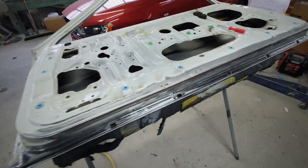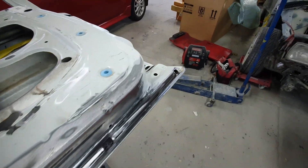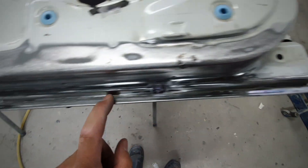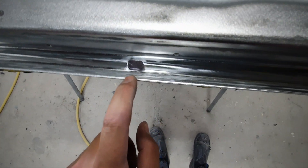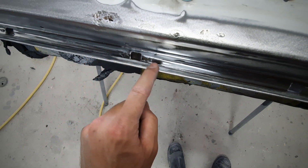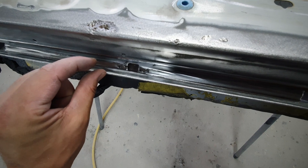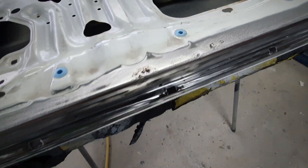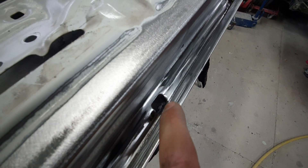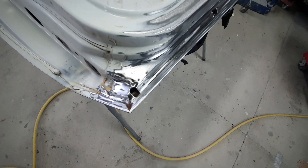Stripped off all the paint off the bottom of my door now. I've found there's quite a few holes going through here — mainly there, there, and a couple here. Most of it's pretty clean at the bottom, but there is a little bit of rust lurking in between the skins — you can't really see it. This is probably the worst bit underneath — got all this stuff here with some holes. The skin is actually raised up, bubbling underneath on this internal skin. So I'm going to try and attempt to roll the lip around and clean it out the best I can with some rust neutralizer. A little bit more through that area, just where the drain holes are, and a little bit in this corner. So I might lift it up to about there and see what we find.